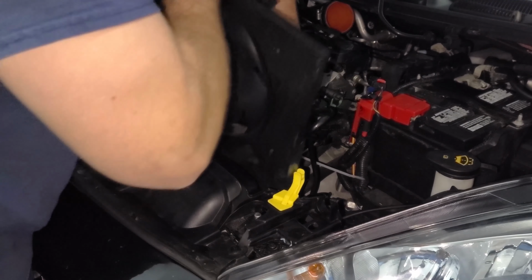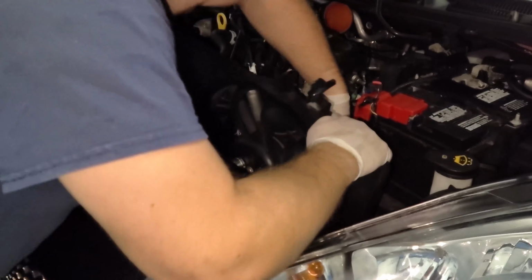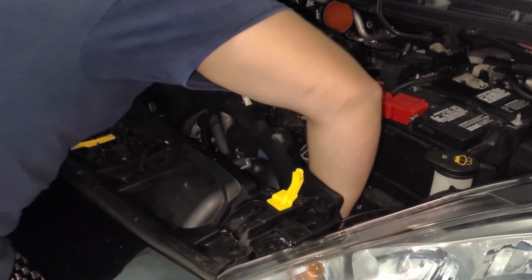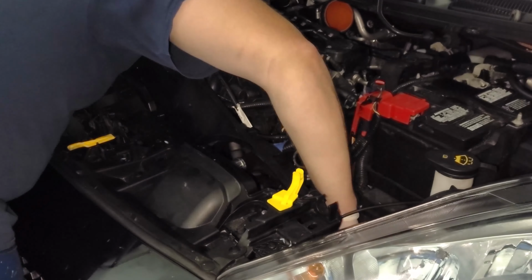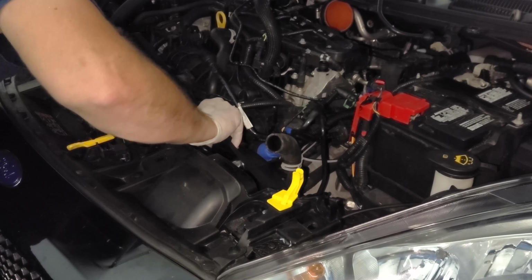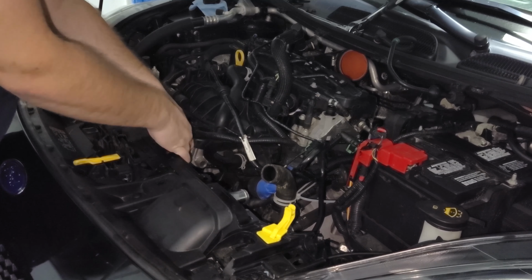Remove the upper tab holders using a 10 mm wrench or socket. Then reinstall the fan shroud, being careful not to damage anything in the process. With the shroud back in place, reinstall the upper tab holders with the tabs in place. Then take the vent plug and install it on the new radiator. Also, pull the radiator forward to insert the upper post bushing plastic covers.